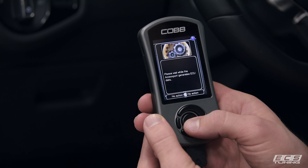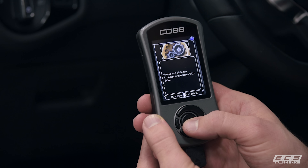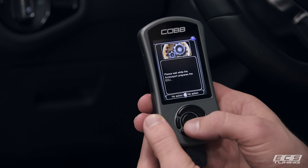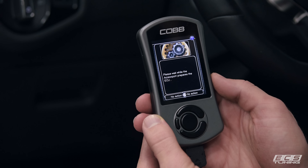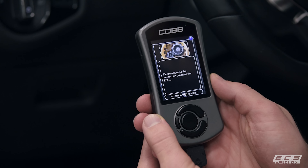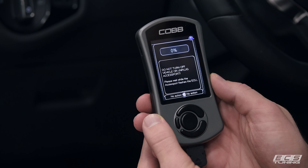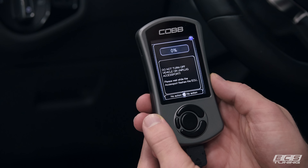It's recommended that you put a battery charger on your battery while you're flashing, just to make sure that low battery doesn't corrupt your ECU — especially on the initial install, because it's going to take longer than any subsequent flashes. We're flashing now, and we're going to speed up this video for you, but this did end up taking us about 20 minutes.